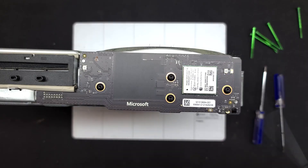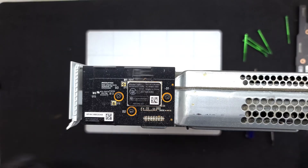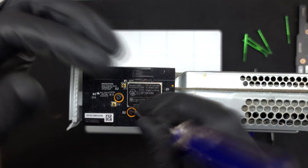There are two daughter boards on the console. One is under the front panel, and it has the eject and power buttons, with four hex screws holding it on. Along the side of the console, you'll find the WiFi and pairing board, held in place by three of those same screws.